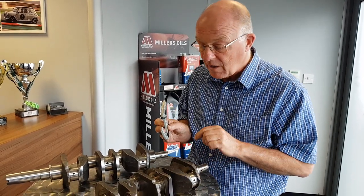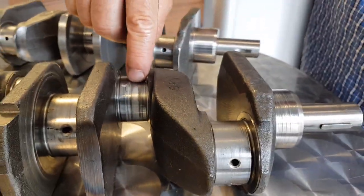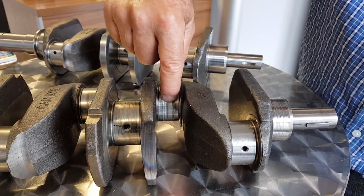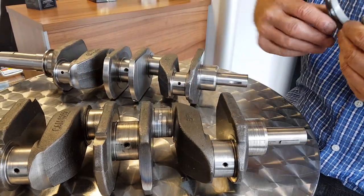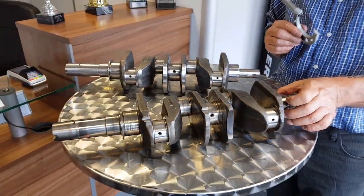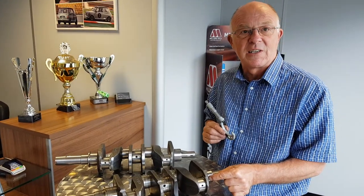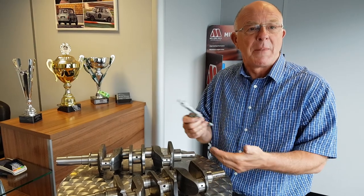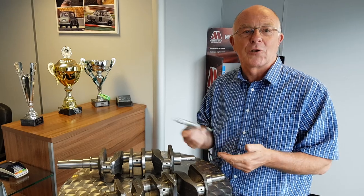And as you've just noticed, you can see where it's just about ready to knock the big end out. You'll see the bearing shell has actually welded itself partially to this big end. If the engine was running you would feel it rumbling. If the crankshaft's 2 thou undersize, the bearings are going to be 2, 3 thou undersize. So you're going to have a crankshaft that's flapping about in its bearings by 5 thou, and it would rumble like billy-o. And if you've got an oil pressure gauge in, you would be down below 20 psi.